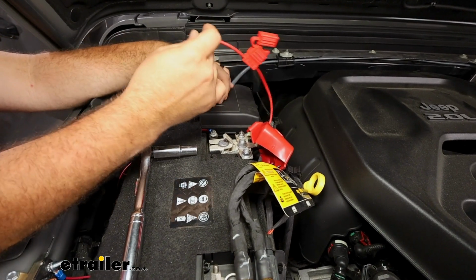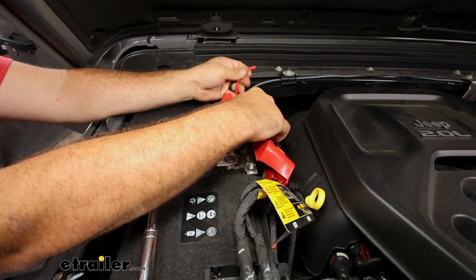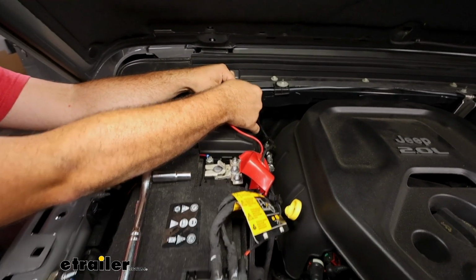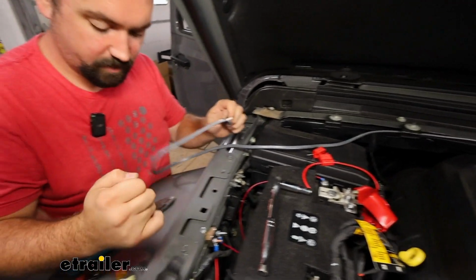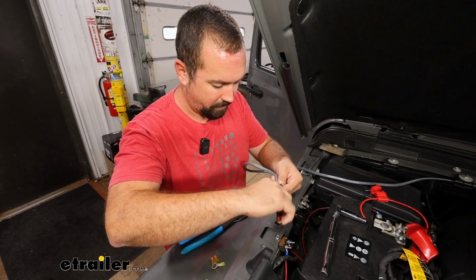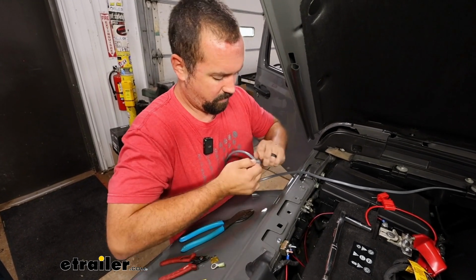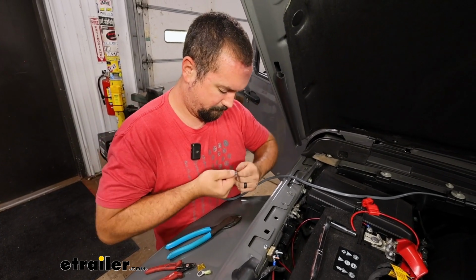And then this will connect to our white wire from our duplex. So seeing where our wire runs, I can actually cut this back a little bit, but I'm going to strip back our sheathing to here. And many times if you put a small slit, you can peel this to where it rips. If it's giving you a little trouble, you can run a razor blade along here. Just make sure you're not cutting into the wire as you do that. But once you start peeling, it should come off fairly easy and you'll be able to split it.